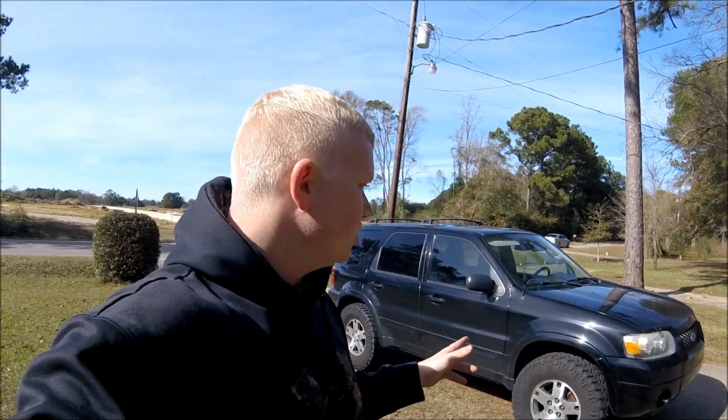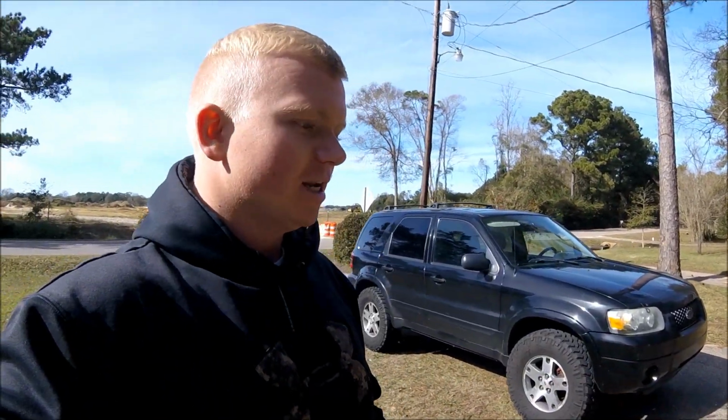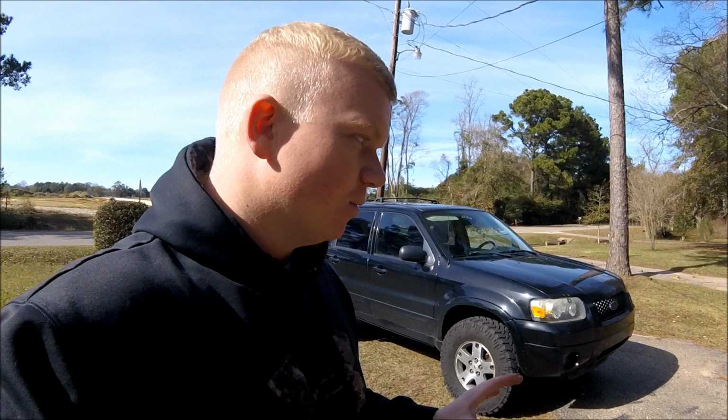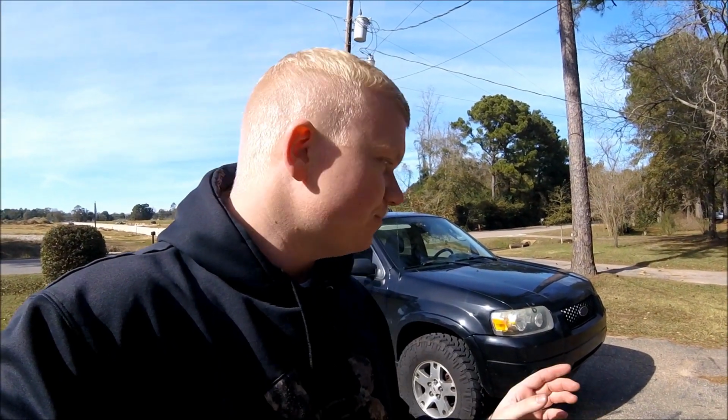What's going on, YouTube? This thing's filthy right now. We just drove up to Boone, North Carolina to stay in a cabin with my in-laws, and we had just replaced the tie rods on this car. If you've seen my video about that, I had some issues with the steering. It was kind of jerking and shaking. The steering wheel was crooked whenever you gave it gas, and then it would straighten out when you let go. It wasn't right, but we fixed that issue with the tie rods.